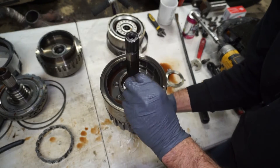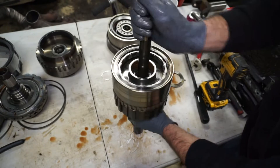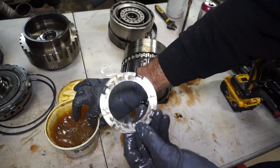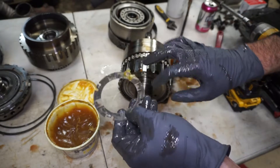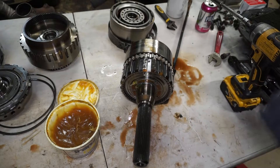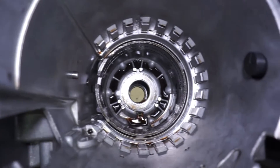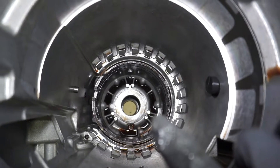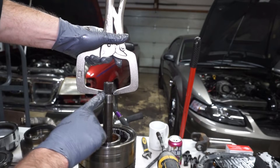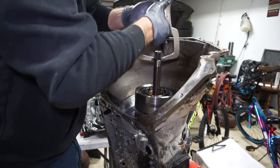I'll throw the bearing on and throw the low roller sprag back in — that section is inspected, all good. I can't get it off easily but I want to put some assembly lube on it so it doesn't fall off when I put it in. I'll take a little blob of assembly lube and put it right on, just so it doesn't come loose when I hang it upside down to put it back in the case. This three-tang washer goes on the back of the case — each one of those three tabs goes inside the little nubs sticking out. What I like to use is a big C vise grip clamped on this groove on the shaft so I've got a nice handle to lift it and drop it in the case.